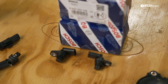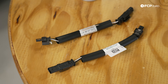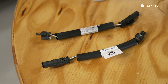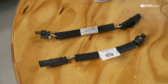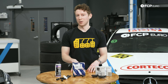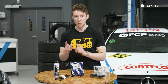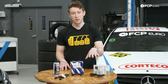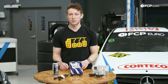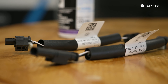A big part of the solution is these sacrificial pigtails — this is actually an original genuine Mercedes piece. These were made by Mercedes back in the mid-2000s originally for the M271 engine, with fitment also on M272 and M273, and they were made to solve for the very same issue. Oil was coming in through the camshaft magnets, making its way into the harness and causing a host of problems. Mercedes made these little pigtails specifically to splice into the harness and collect that oil, keeping it from going into places that are a lot more important.